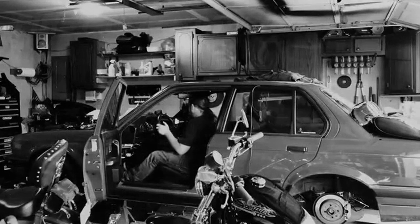Alright boys, months later as you can see. As you've seen from the previous clips, I got the car started up — the first start and the second time. The only thing I have problems with right now is the car's not idling and it's running pretty rough. So we're going to get that fixed. Gary seems to think it's a problem with the vacuum hose. But apparently the problem with the car was these relays. My car only had two, but I had my friend come over and do all the electrical tests with the continuity — shout out to Josh for that and his buddy Cody. He took one of the old ones apart and there's a switch that allows the power to go from one thing to another to power the fuel pump. He took the casing off and squeezed it together so it was automatically sending the power through, and it seemed to fix it.